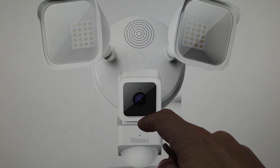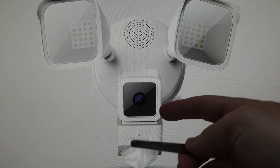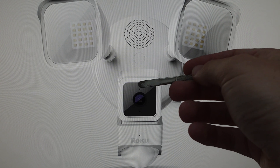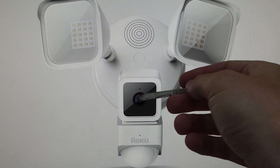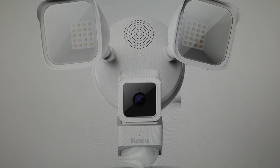You're going to access the setup button and press and hold it for 10 seconds. Before you do this, you should remove the SD card from the camera. So press and hold that setup button for 10 seconds, at which point you can release the button and just keep an eye on this indicator light here. After about 30 seconds, you should see if this reset was successful — the whole thing will actually turn off and turn back on, and then this light will be flashing red, indicating that it's entered setup mode and you can go ahead and set it up as a new camera.